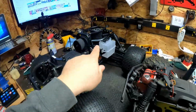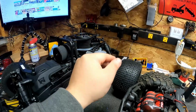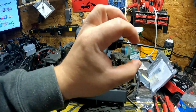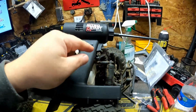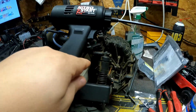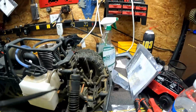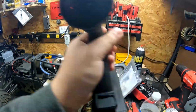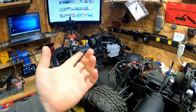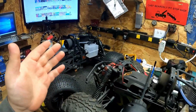So the newest one comes with a pull start now. It's not bad because there's a one-way bearing on the engine and stuff. It works. The old Roto Starts used to have a one-way bearing on the starter case cover themselves, but this new one, the one-way bearing's in this gun, so it's literally just the starter shaft that's on there. There's no one-way bearing on the engine anymore. It blew my mind. I know it doesn't sound right, but this just goes into the back of the engine back here and you pull the trigger and she starts up. So I really don't know why they didn't go this route, and they went with a pull start. I do have a new back plate for that, so I can use this Roto Start. I think that was kind of a missed thing.